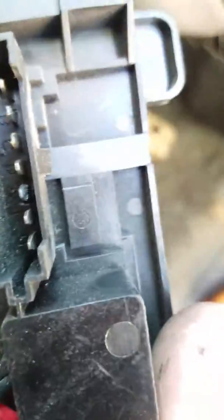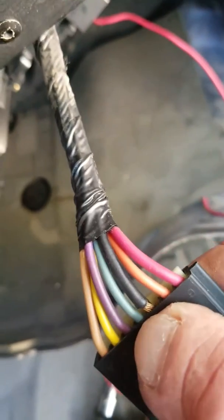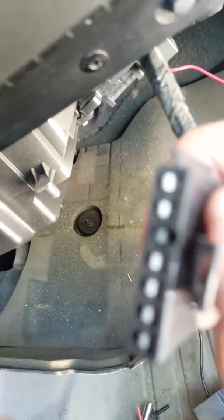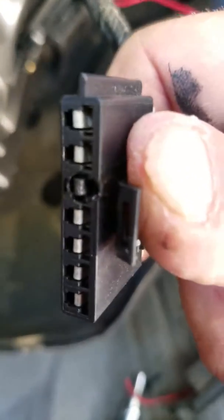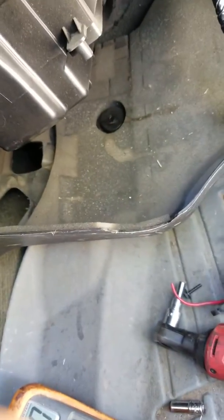That number three pin — I can see it's the one that gets cooked. It's a black wire right here and you'll see it's melted. This truck smelled like smoke today and now you can see that pin is burnt. That's a ground — it's not power, it's ground.